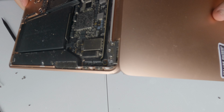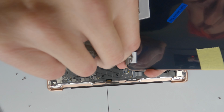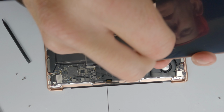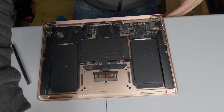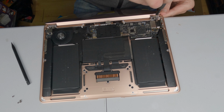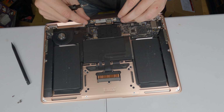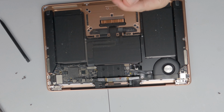The first thing we have to do is get these hinges open. Now the easiest way of doing that is with a screwdriver. First of all, if you put that in there, you can now open this hinge really easily to its maximum. By having it off the edge of the table, we can easily put in one of the screws into either hinge without doing any damage to the ribbon cable that is here. Once one of the screws is in, close the laptop, start reassembly.